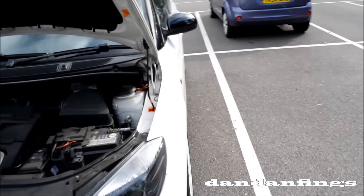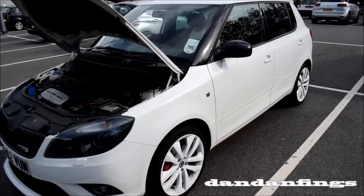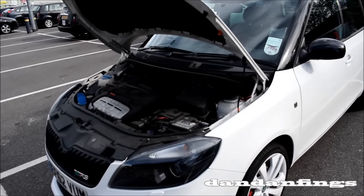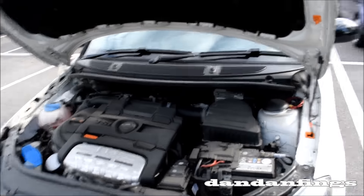What else I've done to it was the exhaust, as you noticed. That made a big difference with the response. I took out the midsection, so it's a straight through, just a back box. That combined with the sound deadening removal has made a massive difference to the car for day-to-day driving.